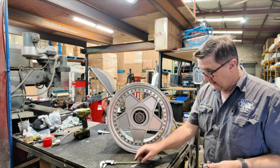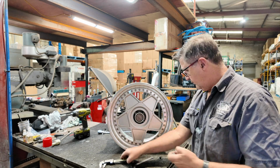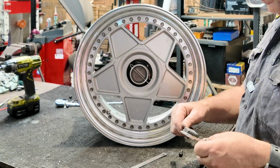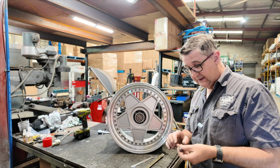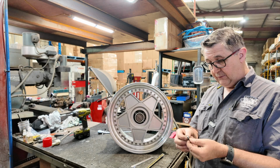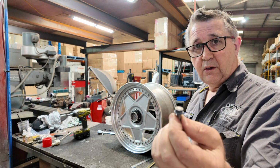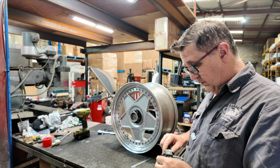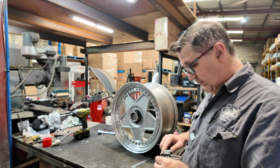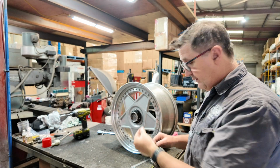So your nut, actually, let's measure it. Oh, it's nearly 2 mil, 1.9 millimeters deep. So the rest of those bolts on the back there look like pretty much dead flush, like that, right? So we button that out, 1.9 millimeters. That's how it's going to be, okay, if you reverse mount it.